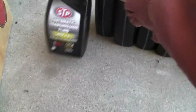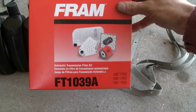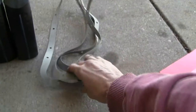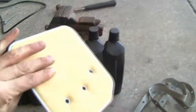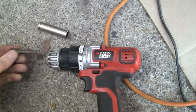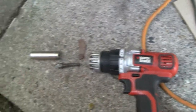So this is the fluid I've got. Apparently it takes nine quarts. And this is the filter I have right here for this particular vehicle. Of course, they send two gaskets along, and the actual filter is right there. What I've got going here is a little adapter to put in my gun and a half-inch socket. I'm going to use this to try to get all those bolts out.